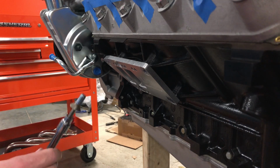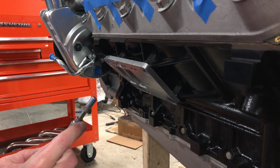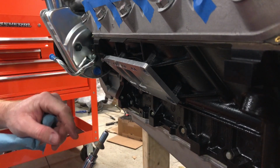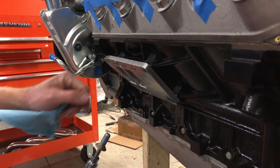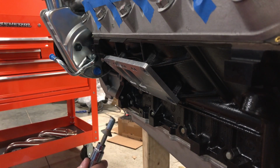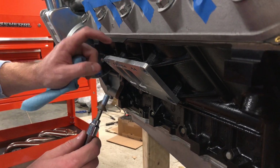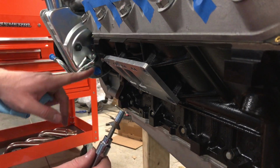So the way I get around that is I put just a tiny little coating of anti-seize on the back of this flathead on the beveled edge here, so that between the two, where they're contacting, I mean, this is 100% contact in this cone here. So what that does is it prevents them from corroding together. Well, it slows them down. It doesn't prevent it, but it slows it down so that when I want to take this off someday, I will actually be able to get it off and not have to worry about stripping this out and then have to drill all this out.